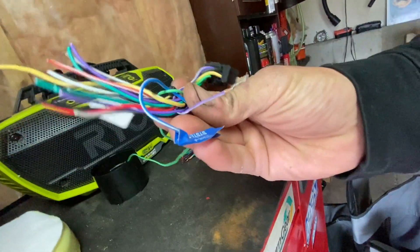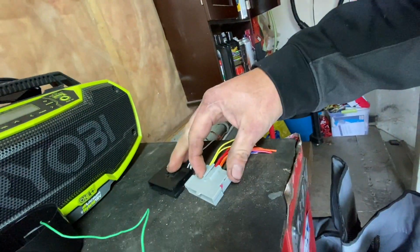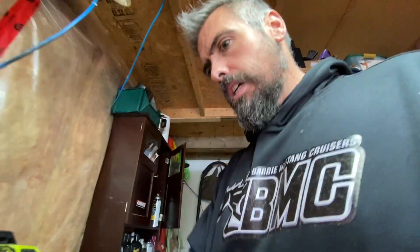So I got my wires — this is the wire for the radio right here. These are the connectors for the factory Fox Body harness. What we're going to do is connect the speaker wires and everything here. I've got heat shrink tubing somewhere, and then we'll start connecting the power wires together so it's nice, and then we'll start putting the radio in.